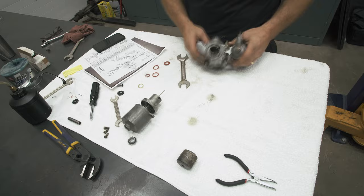Everything is run that I can think of as far as fuel, air, and spark. The clutch should function as well, brakes should function reasonably, and we know we have spark to the spark plugs. It'll just be a matter of putting some oil in the oil tank and fuel in the fuel tank and we're ready to fire it up. We are completely assembled with the Fonz bike. I have some fuel in the tank. We had a couple little leaks, we squared them away, and we have some oil in the reservoir as well. Now it's a little bit of a test to the pudding here to see if we did this right. I'm really praying that this is going to work out the first time, and if it doesn't, well, we'll figure it out.